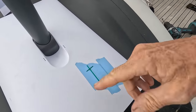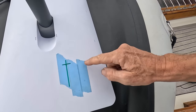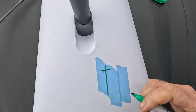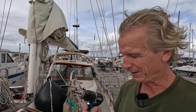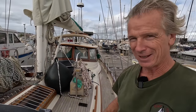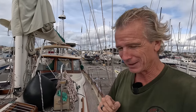You might notice I've already got a mark on here with some tape — that's the place I want to drill through. If you look online, basically people are saying five inches, which is 12.7 centimetres in from both edges. Now it looks to me that when people have done that and drilled the hole, it ends up being slightly over here, so I'm going to aim a little bit off. People are drilling inch-wide holes, but I've got a 12mm Forstner bit here — the best bit to use because it hasn't got the big sticky-out bit that auger bits have that might catch on anything inside. You mustn't push hard and actually damage any of the board inside.